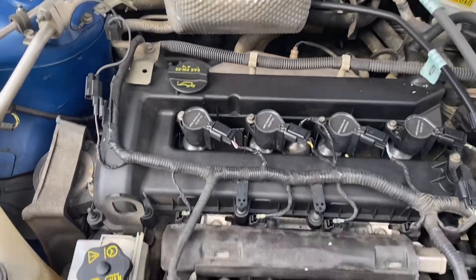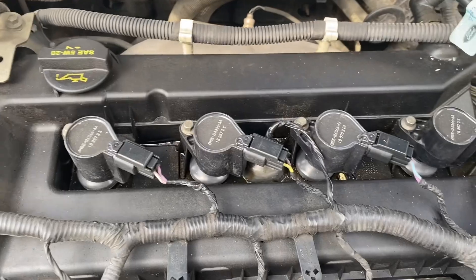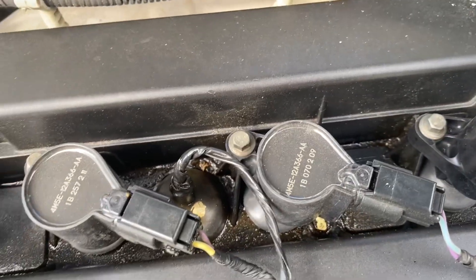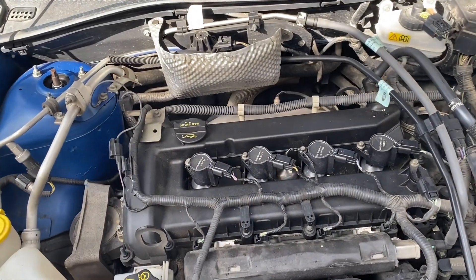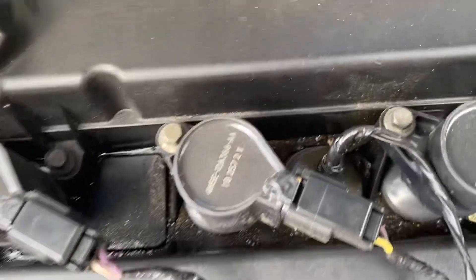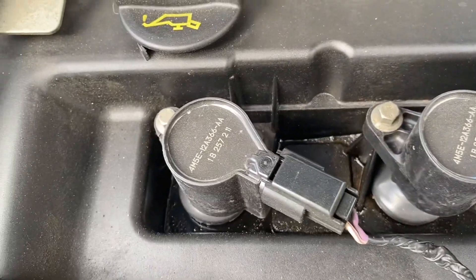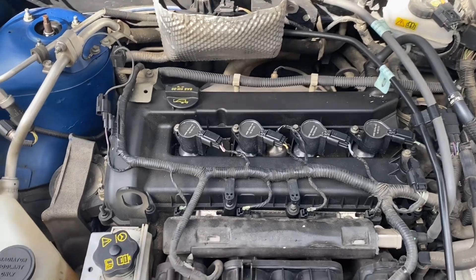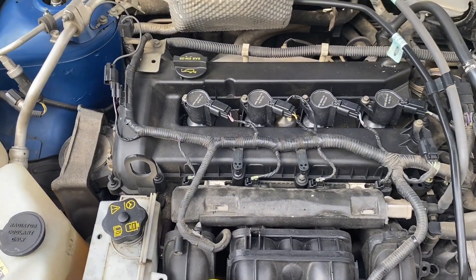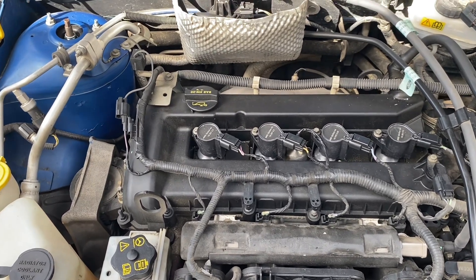Now for another update on this car: my car had issues starting, and the cause was cracked ignition coils — this one and this one were cracked. I ended up replacing all four of them just to be on the safe side. Also, my valve cover has been leaking oil, as you can see right there. Next weekend, me and my buddy are going to replace the valve cover gasket and get that all cleaned up. I'll be filming the entire thing, so stay tuned for that video.